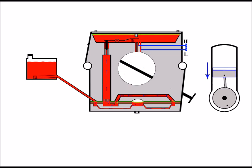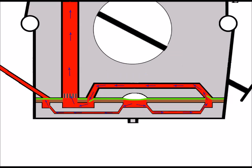But the fuel pump diaphragm itself can also cause problems with bogging down. Of course, though, when it's operating okay and everything's working as it should, there's no problem whatsoever. But problems can occur mainly when the diaphragm ages or when a substandard diaphragm's used. So here's the fuel pump diaphragm. And if we take a look at that valve there, it's opening and closing the way it should do. And the right amount of fuel is coming through so that the Venturi can be filled with the right amount